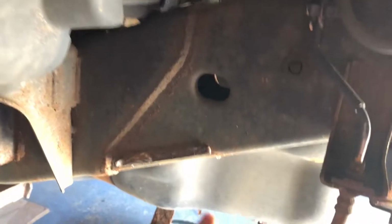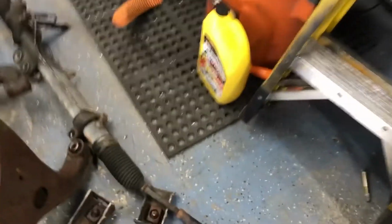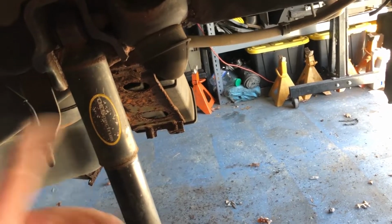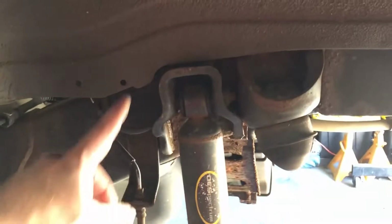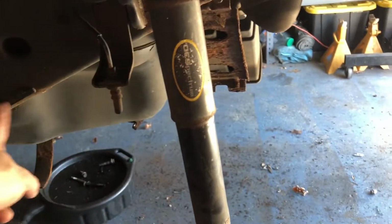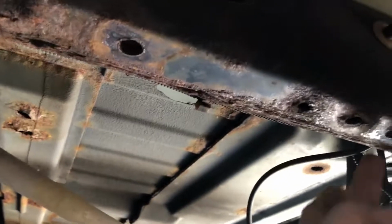And then in the rear, we removed the whole rear subframe, also removed the front mounting points from the frame. Even though the rear of the frame on a Frontier and Armada and Xterra and Titan and Pathfinder are all the same shape, the contour and the width of the frame are the same. The difference is basically the Titans and Xterras and Frontiers have leaf springs in the rear, and the Pathfinders and Armadas have independent suspension. So they have these mounting points on here, a bump stop for the independent control arms, a mounting point for the shock in a different location, this mounting point here that is cut off for the front of the subframe, and then the rear of the subframe bolts up into the frame in two locations here.